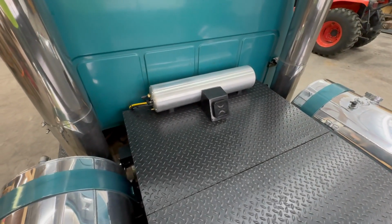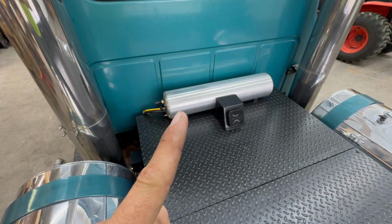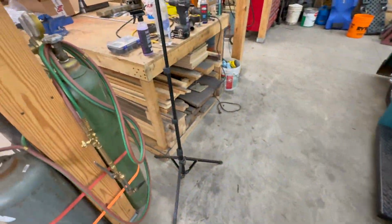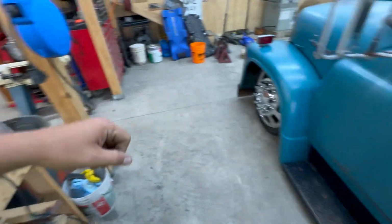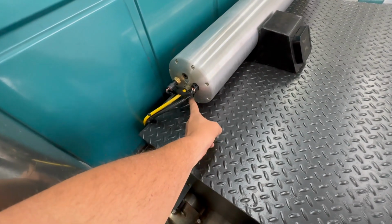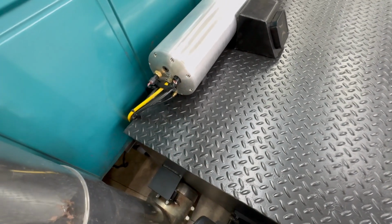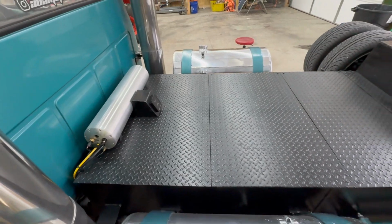And then I'm gonna build a little box to elevate that AccuAir stuff up the tank. And then that little guy is gonna end up in the front of the box. And then we have, where's it at, right here. Has some 3/8 aluminum that we're gonna actually come out of each end of the tank here. And these are gonna bend to 90 and go down through, so it cleans them up so they're not all nasty running around the side. And obviously all the wiring will go directly down into that box too. So yeah, I got a little bit of work to do.